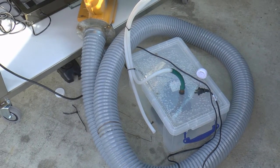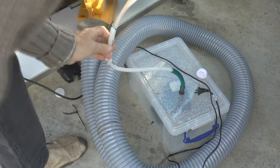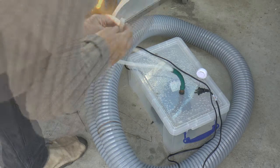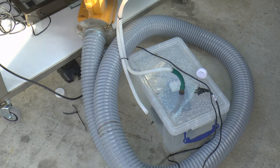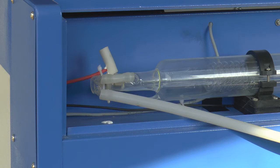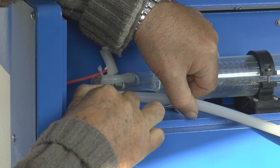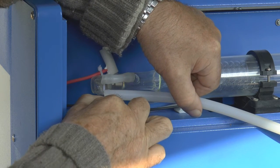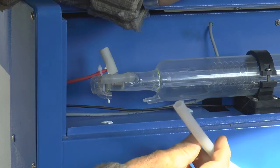The first thing I've done is drop my water tank down onto the floor, and in doing so most of the water has already drained back into the tank. I can see there's still some residual water left in the tube itself. A bit of a blow through the tube should remove probably 95% of the water so that when I take it off it isn't going to run everywhere. At each end of the tube there is a water connector. I've got to be very careful because I don't want to break any glass — with a little bit of pulling on the tube and pushing with my fingernail, the tube has just come off beautifully.